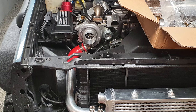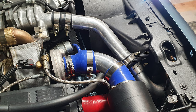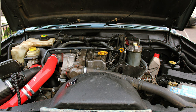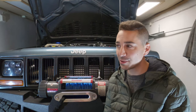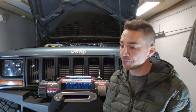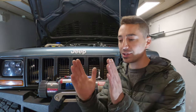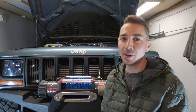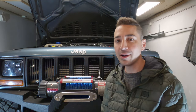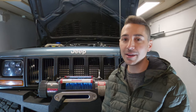Perhaps you can change your intercooler piping from rubber piping to aluminium piping or stainless steel piping, or even silicone piping is a good thing to do. Silicone piping is good because it is a little bit stiffer than the standard rubber you get with the engine. It's less susceptible to rotting with the oil. When you have that standard rubber piping and you get all that boost coming out of the turbo, you will see that rubber expand. I guess it's not a loss of pressure technically, but it is adding a little bit of turbo lag and a little bit of response that you might get off the bat. And if you're hunting for performance and being real nitpicky about it, it is something you might want to address.